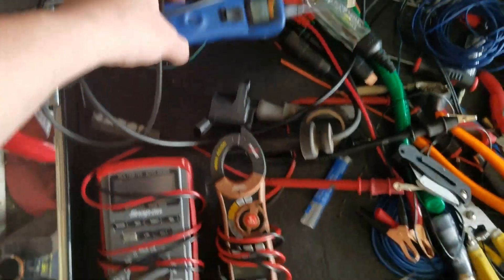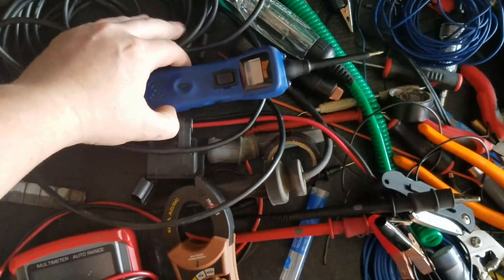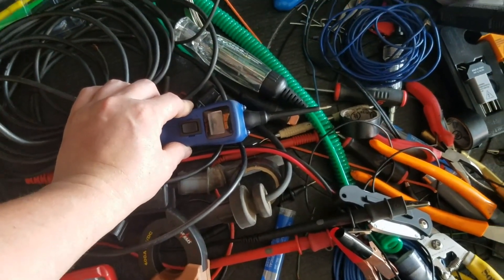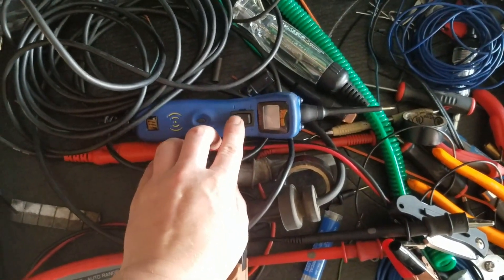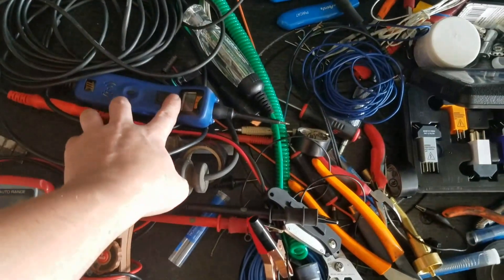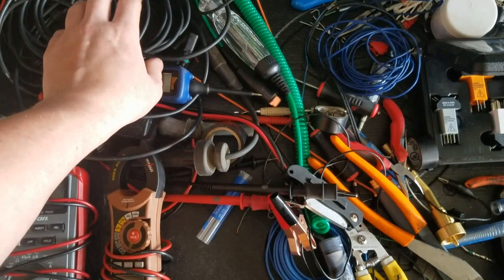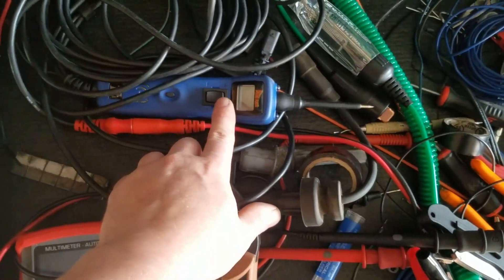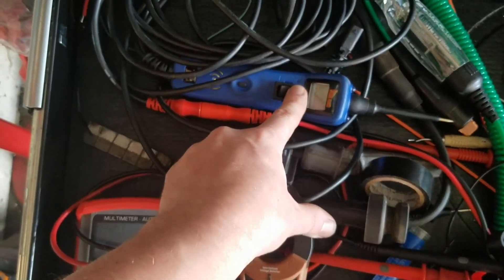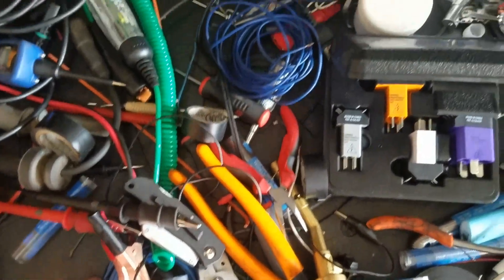You can put this clamp on a wire and tell how much amperage is going through it. This right here is a Power Probe — this is my go-to electrical testing tool. It's got two leads that go onto the battery. It has a ground lead, and you can do many things with it: test for voltage at a relay or component, and also use the buttons to supply power or a ground. For example, if you were trying to test an AC compressor, you can go to the relay, find your diagram, find out which pins do what — 30 and 87 are always your power, 85 and 86 are always your signal and power for the coil. You can go right to pin 30 and 87, probe them, find out if you have battery voltage, then go to the coil driver side and push the button to supply power directly to the relay or whatever component you're testing.